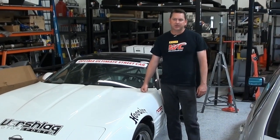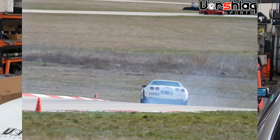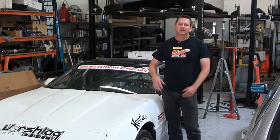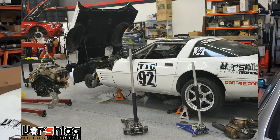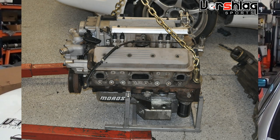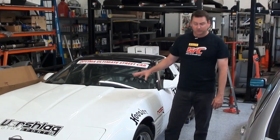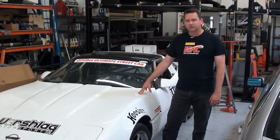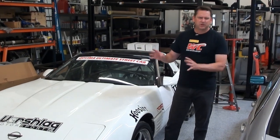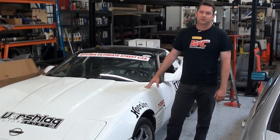We're in the '92 Corvette Project Danger Zone at the second NASA race for this year. We didn't make a full lap in competition because we had some problems with the engine after Olaf fixed all the leaks — we realized there was a lot of excess crankcase pressure and we think it's got a broken ring, with a lot of metal in the oil pan. We've already pulled the motor and shipped it off to HK Racing Engines; they're going to rebuild it to the legal limit of the rules — no gray areas, all legal. There are also a couple of things we found about the roll cage after someone wrote in to the national office — one or two tubes we're going to change, fairly inconsequential. We want to make this car squeaky clean legal, and it should be up and running again by mid-June for Hallett, NASA race three, NASA Texas.